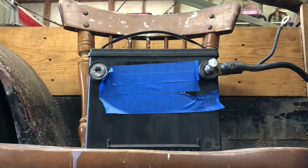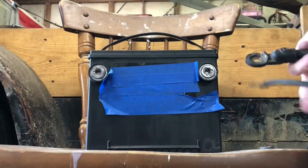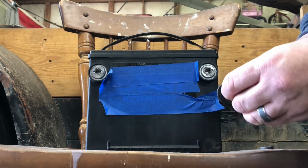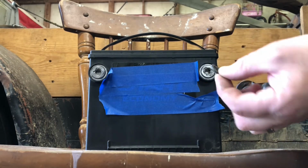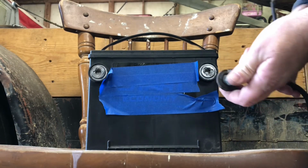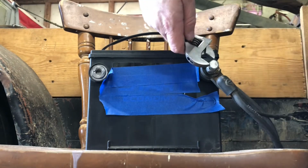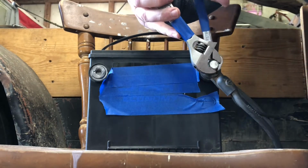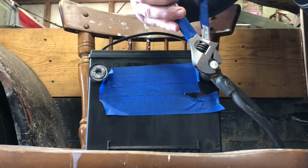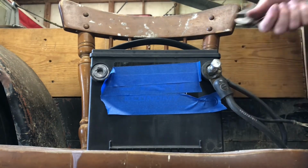It won't back off. If you have multiple cables, I like to try to put a lock washer between them. Take your outside cable and your bolt with your lock washer on there. Start it in. Take your other lock washer, put it on, put your other cable in, same process. Tighten it by hand. Hold it down and wrench. There you go. Tight, multiple cables, good connection.